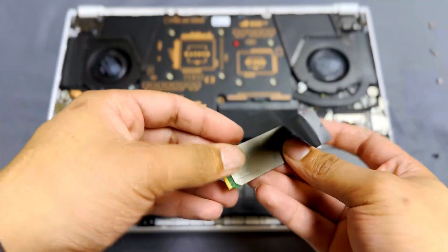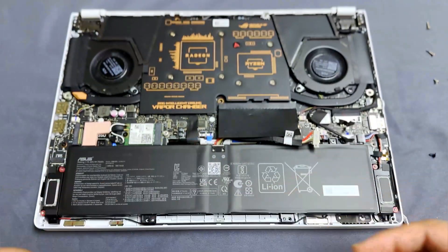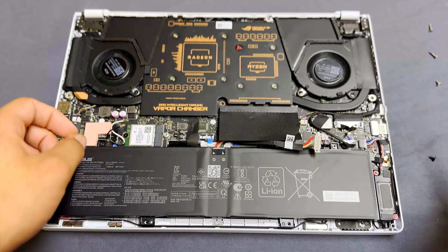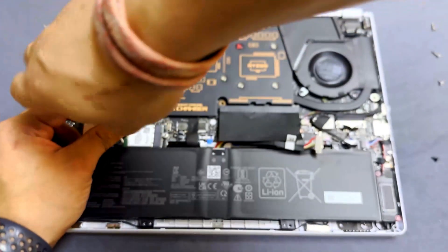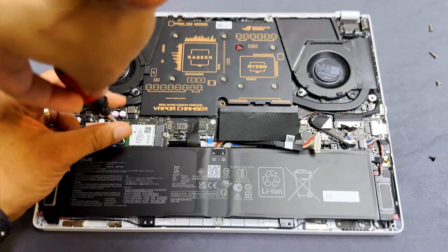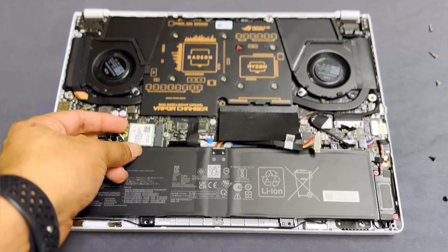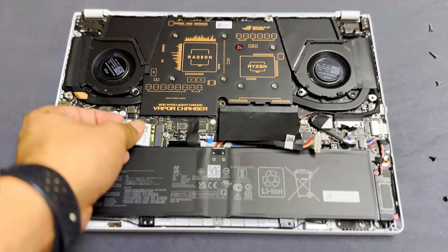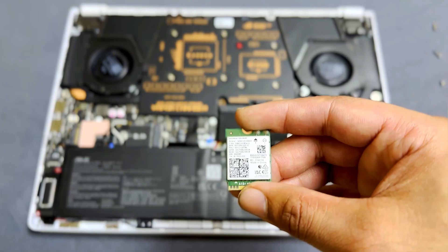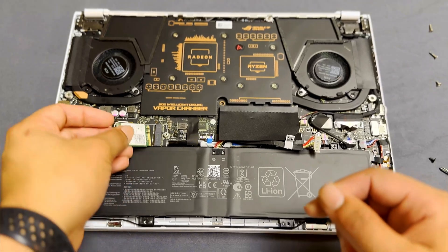Once you get out the old SSD, you'll see it's very OEM-looking, but we'll probably reuse the tiny heatsink so I'll set this down. Next, remove the antenna cables from the Wi-Fi card, remove the screw securing it to the board, give it a wiggle, and slide it out. This thing was just completely awful — I don't know how it made it through testing or why they're still shipping these, but we'll be replacing it with the hopefully much more reliable Intel AX210 Wi-Fi card with Wi-Fi 6E capability, which I got from Amazon for around 20 bucks.